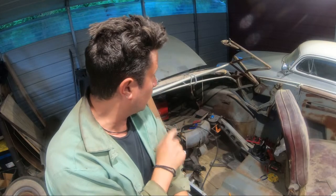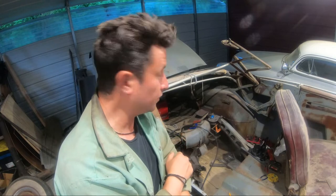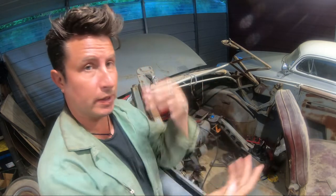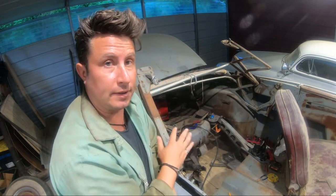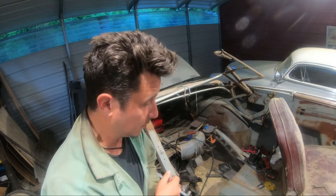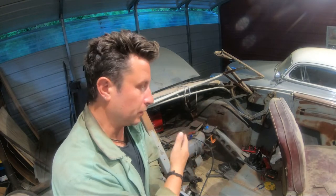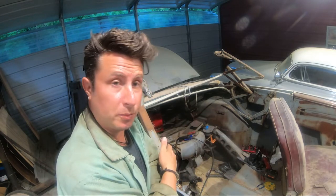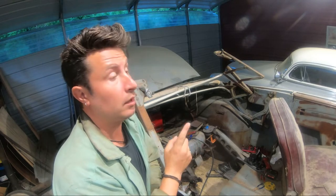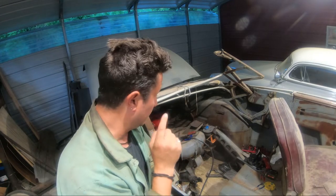We have our upper coil mounts tacked, and I believe pretty well — that welder did some serious work. We've got multiple points to deal with all the forces. We're going to have to fully weld those later. But I don't know if I've screwed this up yet. Let's pretend those are in the right place and the tacks are strong enough to hold the coils. If you put the leaf spring kit in, move on with your life. If you are doing coil springs, coil-overs, or a transverse rear spring like I intended, this next step is something you will indeed encounter: you have got to locate the rear end.